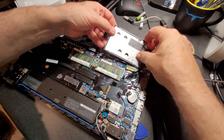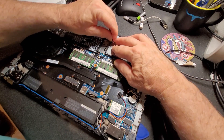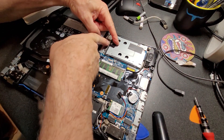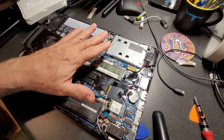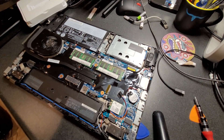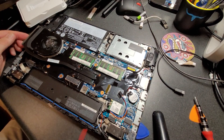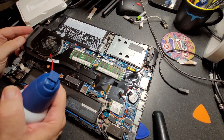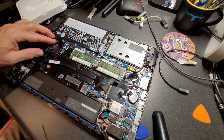Tip this back over and push the bottom panel in — it should snap in at the back. Let's put the bottom on. Like I said, we're going to keep that drive no matter what, so let's get the bottom screwed back on. While you have the computer open, it's always a good time to blow out the fan and get the dust out of here. Make sure you're using air — don't pick up WD-40 or something. That'll keep the system quiet.